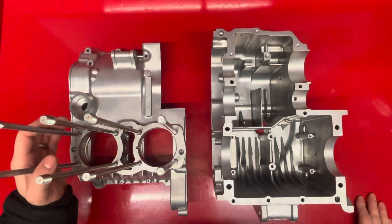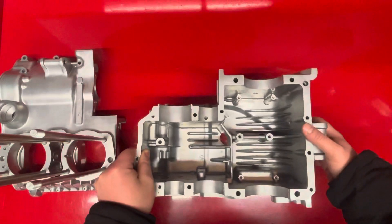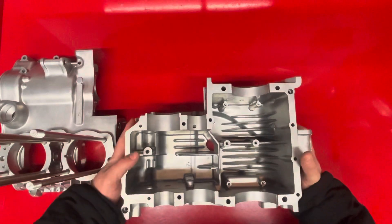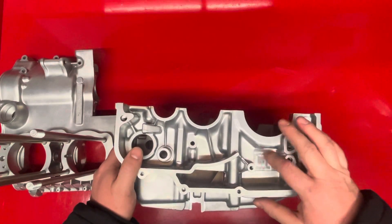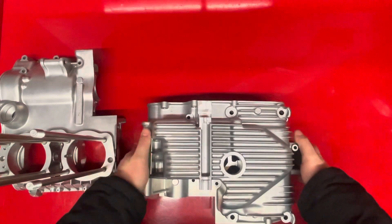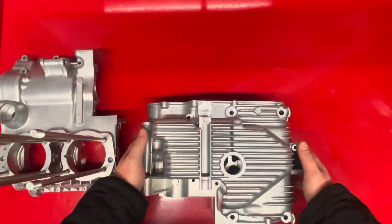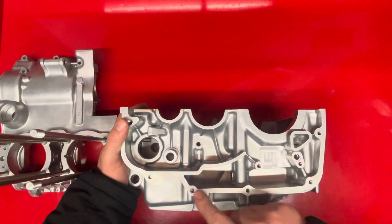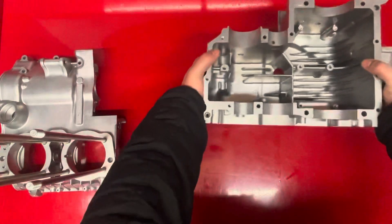So I've done all the work I had to do to the crank cases. I finished drilling up the holes for the splash plate, machined a recess for the oil pump, and I've also put in the clearance for the frame and the exhaust and the bottom. Additionally, I went through all the threaded holes and just ran a tap through them just to clean them up, then gave the case a good clean. So that's ready to go.